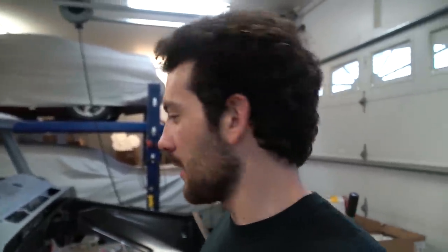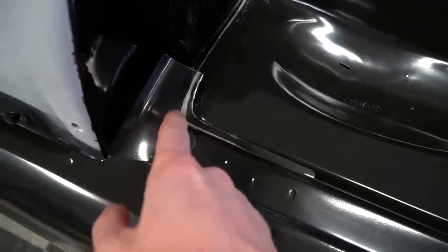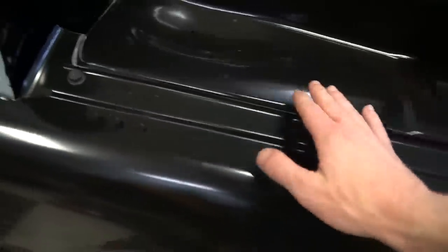Ike and I have done a little more work on the truck since the last segment — just kind of little trims here and there. We install all the panels, make marks with a permanent marker for what needs to be trimmed, take them all off. These are all getting pretty darn close, but that area needs to be trimmed out — we've already trimmed it once but we're going to take it the rest of the way, because this fender needs to push more up against the inner fender and it can't because that little lip is in the way. I wouldn't advise you to do this if it's your first time trying to restore a car — I'd get it sent to a body shop. I would be completely lost if it wasn't for Ike, who has about 20 years of mechanic experience. But this is better than trying to save those old panels or driving to Nevada to a rust-free area to find an old body. Between the two of us, we have about five hours in this install so far — I don't think that's too bad.